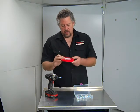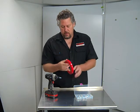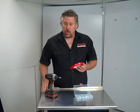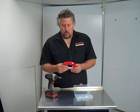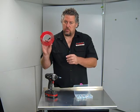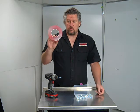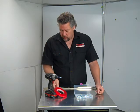Also in the kit, it comes with a double-sided tape. This tape is ½ inch wide — super sticky stuff. This will work really good for mounting the countertops down onto your cabinets. Or when you're doing a filler panel, you can use the double-sided tape. You don't even have to do it all the way down — you can just cut off pieces of it. There's 33 feet on this roll, more than enough to do your trailer.